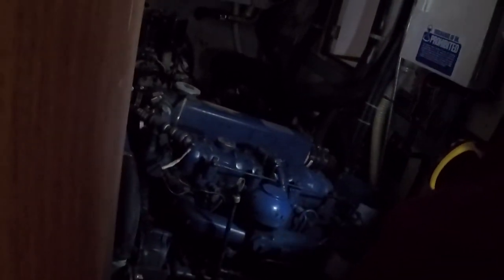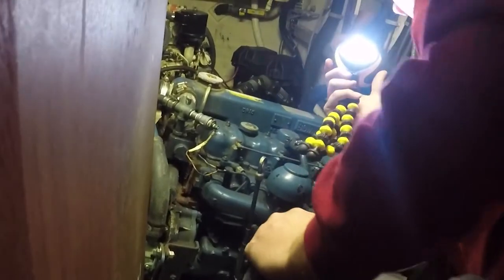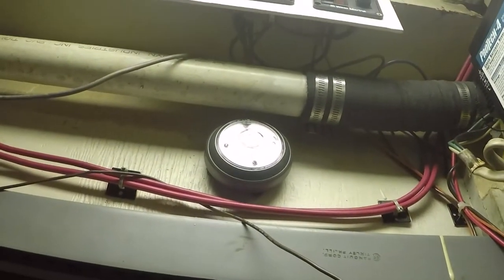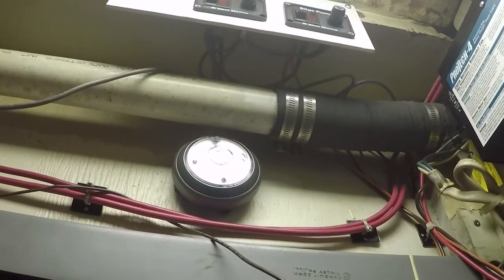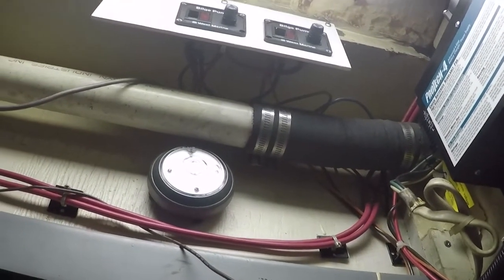You guys are going to have to do a lot of progging — poking, prodding, labeling. Your bilges are clean; they're dry as a bone, this one at least. Here are your switches for your bilge pumps — and this is a heck of an upgrade. You see that red screen? That'll tell you how many times they come on since you've reset them, and they're also alarms. If your bilge pumps ever don't work, check those fuses right there.